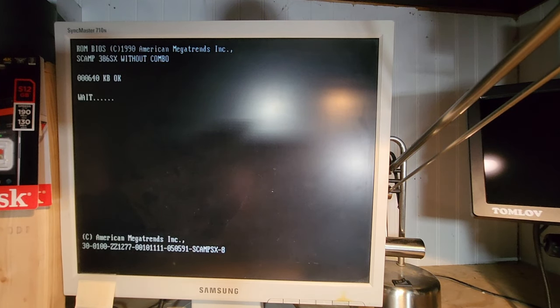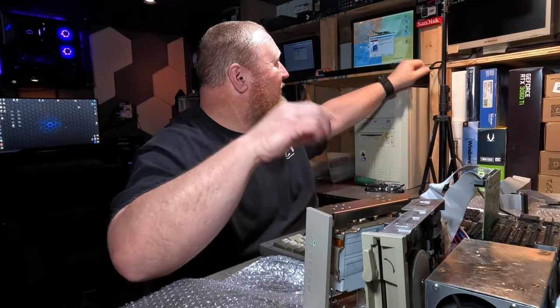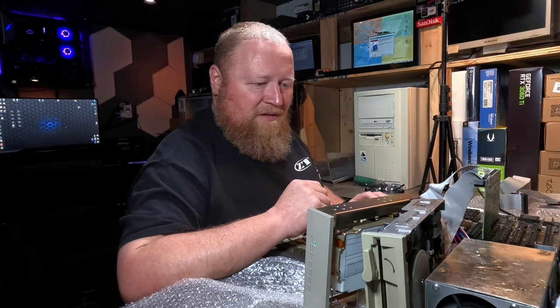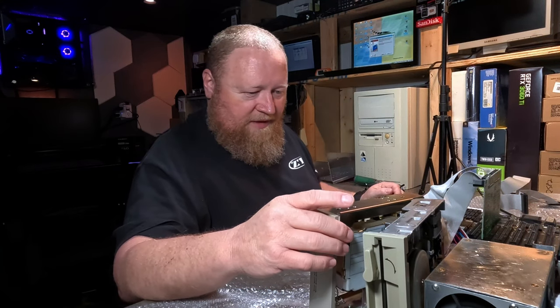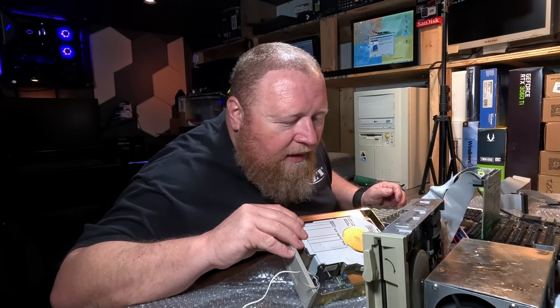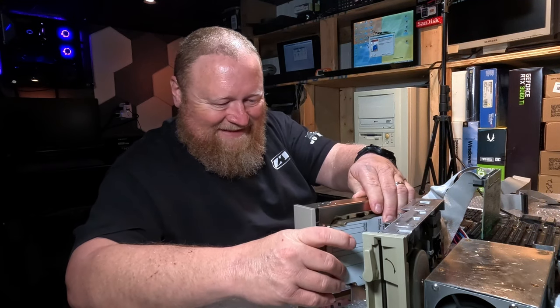Now what? I hear it again. This drive's making some weird noise. Oh look — starting MS-DOS! This drive's making some weird noise. I don't think it's doing well, boys and girls. Not at all. I think we have a dead drive. I mean it works technically, it's just the hard drive is unhappy. And that noise — yeah, that noise is not a good one. I'm pretty sure that's the head making contact with one of the platters.